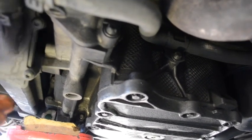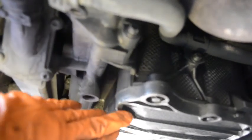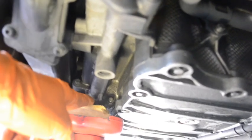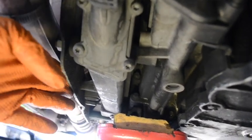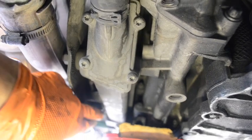I apologize for the handheld — there's just not enough room for a tripod down here. This is the engine oil sump. Just behind it there's a platform where the cases come together, and I'm placing a jack with a block right underneath there, not touching the oil pan but just right behind it. You just want to get the engine basically snug. The engine is supported in the back by a mustache bar going all the way across, with two points where it connects to the engine mounts on each corner.